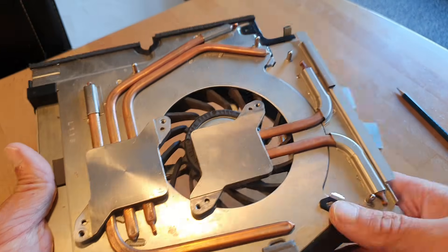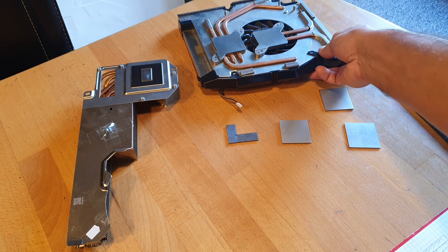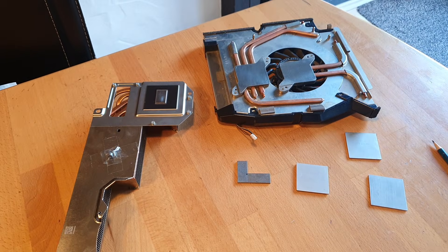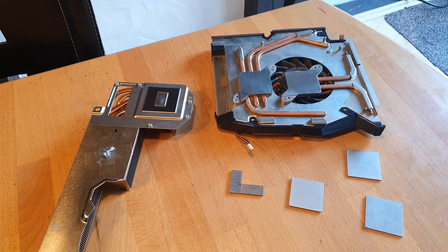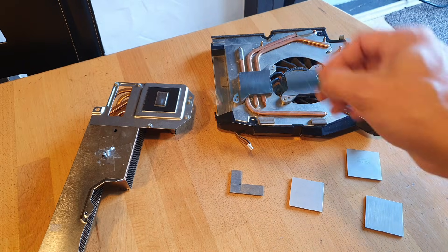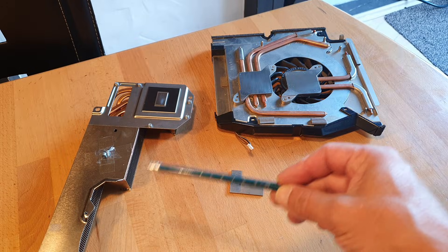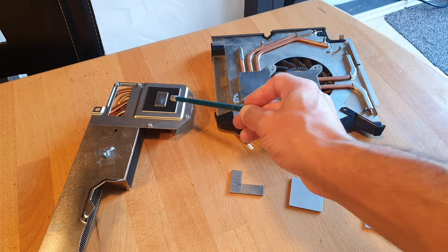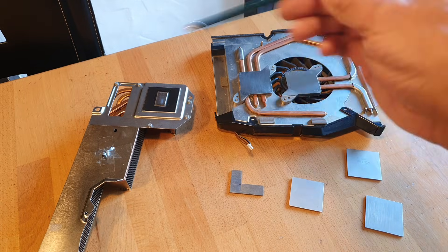This is very important what I'm gonna show you here. I don't know if people are listening to what I say — sometimes I think I'm just talking for nothing, so much information. I have made a lot of videos about the PlayStation 4, which had a big issue with the APU which was bent already — caused, I think, probably by the heat. If your PlayStation overheats for too long, over years, probably the die is gonna bend a little bit. And the problem is also the coolers themselves — when they were not made really great, you're gonna have problems from the beginning.